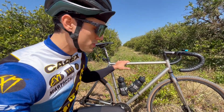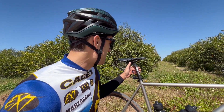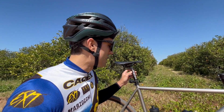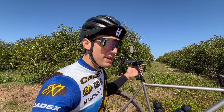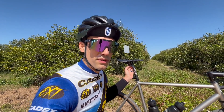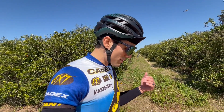I found brackets to hold my water bottles so now I have two in the traditional location. I changed to the Zip seatpost because I needed a little more setback for my reach, and also because a zero-offset seatpost on rough terrain really shoots vibrations into your spine. A seatpost with a bit of setback has some shock absorption characteristics. This one works perfectly with its two-bolt adjustment for perfect angle and setback. I'm in the middle of an orange farm and the sun is hitting the glitter flake on the frame just right.